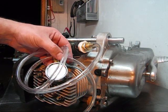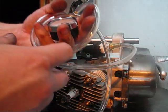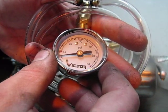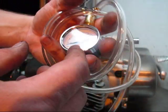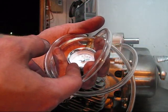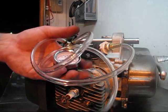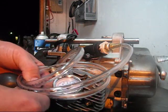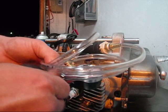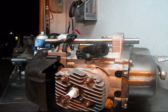We're going to let this sit for about five or six minutes and make sure it holds that pressure. Six minutes later, we're still looking good at 6 psi. One of the ATV tire pressure gauges would work excellent for this. That concludes our pressure test and our engine build — we're ready to go. We're going to let the air out of our pressure tester and pop that out, and go ahead and get the freeze plug out of the exhaust.